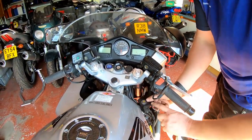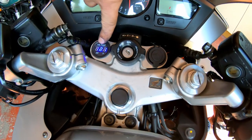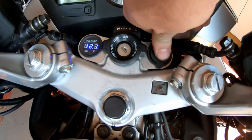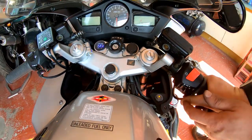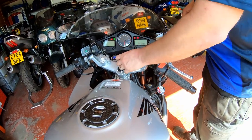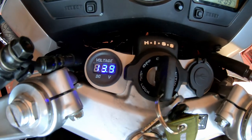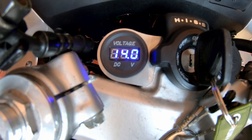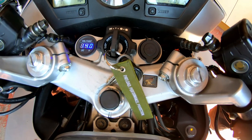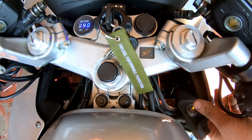Let's give it a go. As you can see, when I flip the switch the little orange light comes on, and 12.1 volts at the battery. We've got a power indicator on the USB ports as well. If we put the key into the bike and fire her up, we should get charging voltage at the voltmeter. 14 volts — really good. Pretty happy with that. Looks quite nice as well — it'll be nice and bright in the dark. And I can charge my phone up if I need to. I'll just flick it on and off as and when it's required.